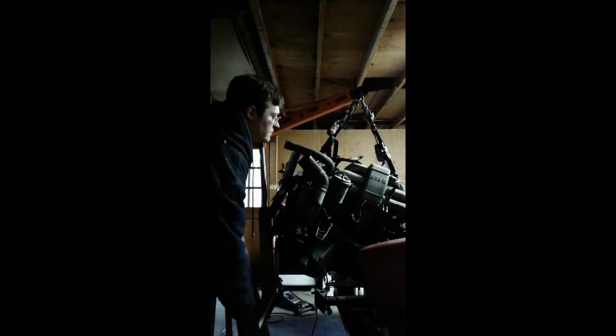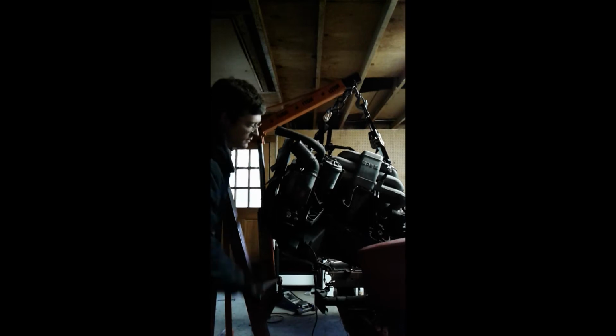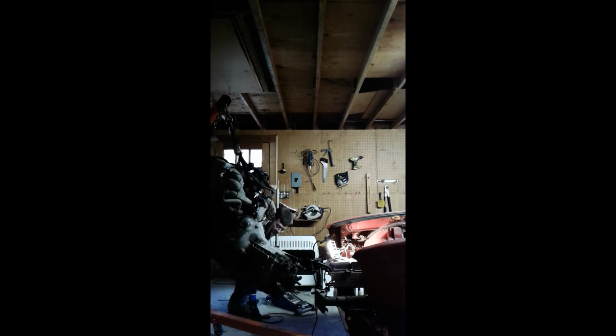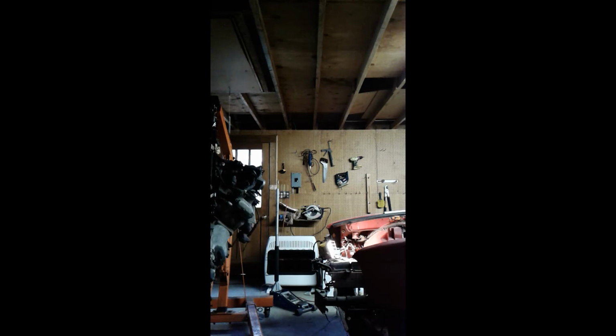And that's in order to make sure that the back of the transmission clears the front of the car now. Pump a bit more. A lot of pumping. Then I gradually inch it out a little bit. It's a little bit tricky just because of the way it was swinging around, so you do have to be careful. It moves slowly, but you can see the bottom of the transmission clear the front member of the car, and then I just pull it back and then rotate it to the side. I'm going to put a pallet underneath it and lay the engine and transmission down on that temporarily until I can get everything separated and get an engine stand. But you're going to see that in the next clip as well.